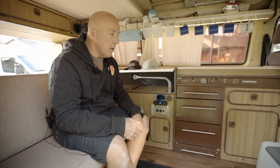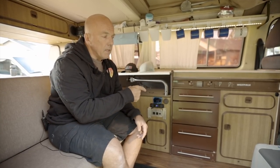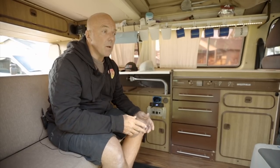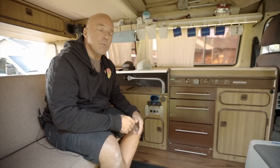That's my power — it runs through a couple of inverters and lasts pretty much days. I've also got a DC-to-DC charger which runs from the alternator and charges while I'm driving, keeping it boosted the whole time. The reason I put that in is because I did a trip to the Redwoods and figured out that when you're in the Redwoods you're not getting any sun to the solar panel.